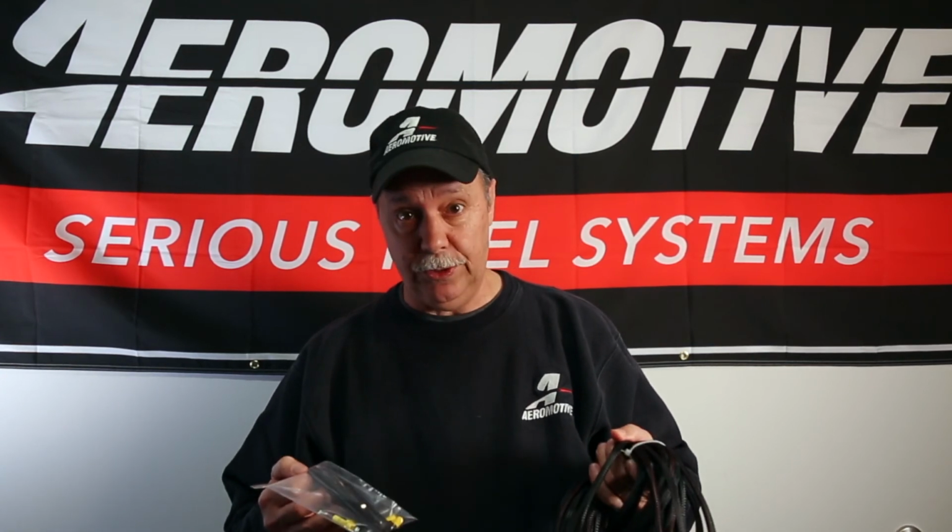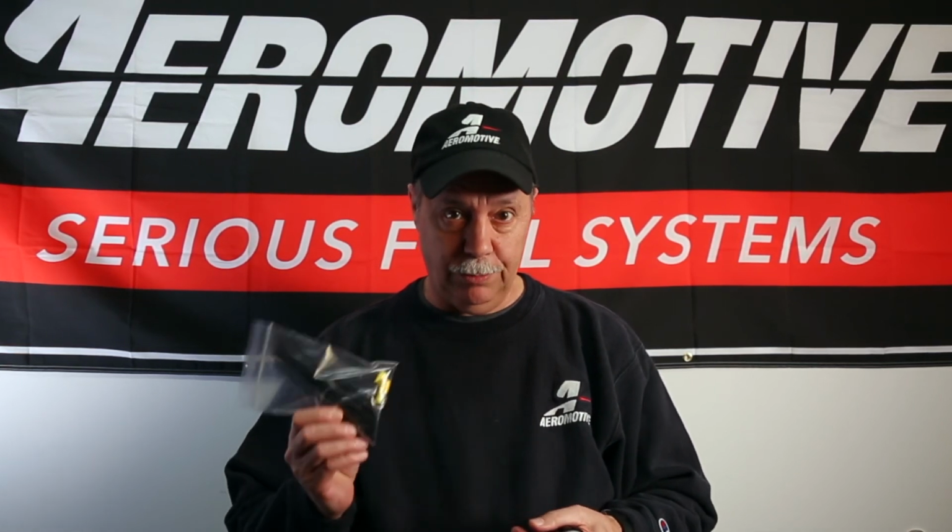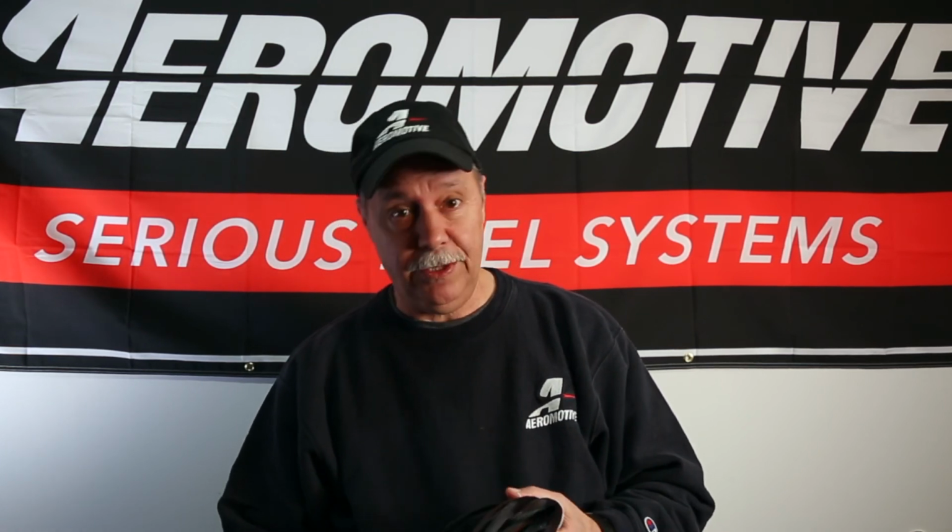And we provide you the terminal ends in the kit so that once you've laid this harness in the car and you've got it where you want it to go, from the battery or from the back of the alternator to the fuel pump, you can cut it and then terminate the ends with the provided connectors. 16307 wiring kit. It's a fantastic product.